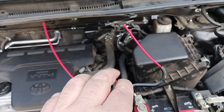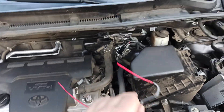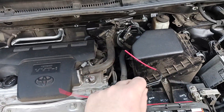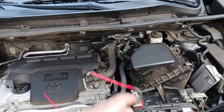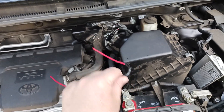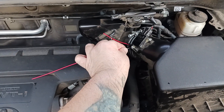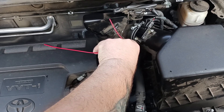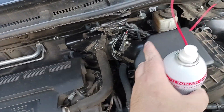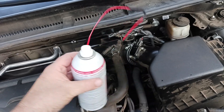What's important is you want to try to get the hose or the tube part as close down in there to the throttle body — the butterfly valve on the throttle body — as you can. With this specific four-cylinder setup, a 2014 to 2019 Camry or Corolla, you really can't get all the way down. The manufacturer's instructions say about a quarter inch from the throttle body, but realistically about four to five inches down is what you'll get. Once you separate the cover from the hose, put the hook and tube in there, re-seat the cover into that hose, and snug up the screw with your Phillips screwdriver. You'll have enough slack on the bottle to play around with.